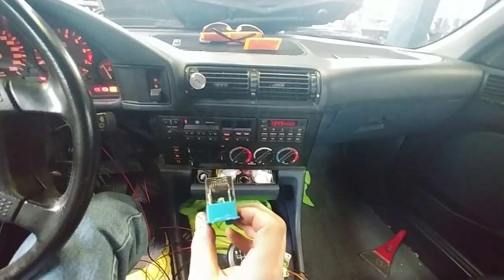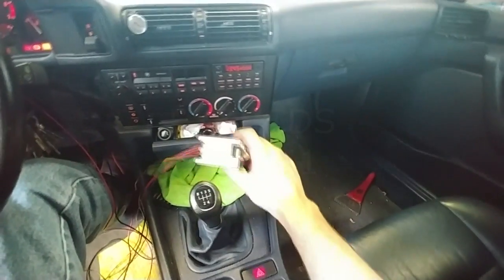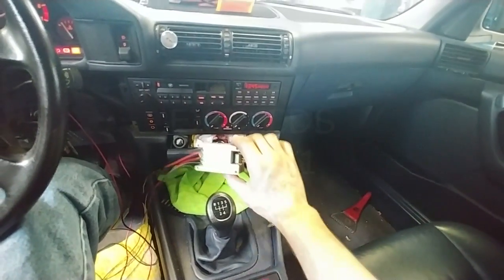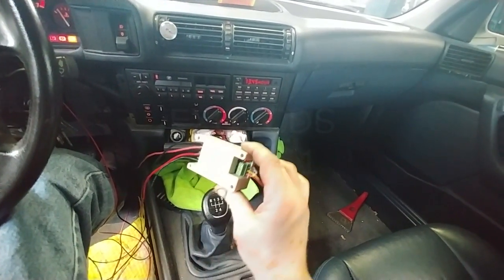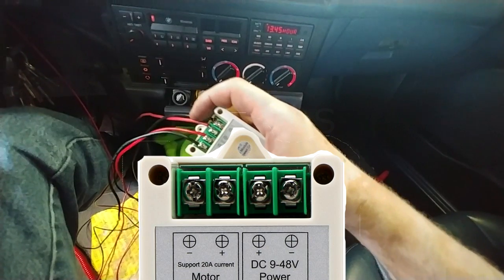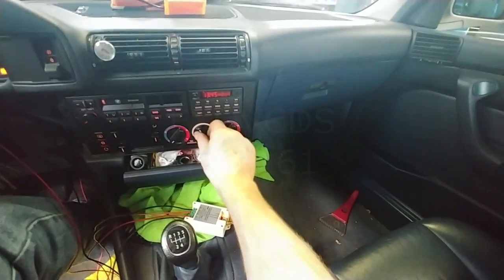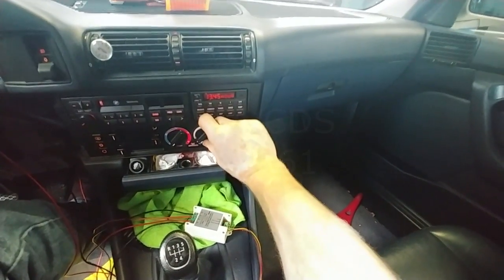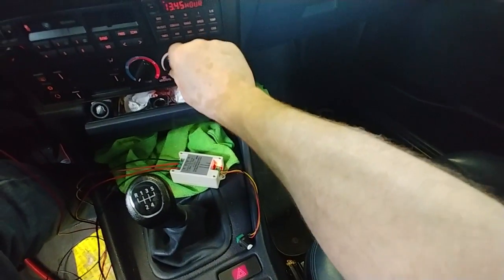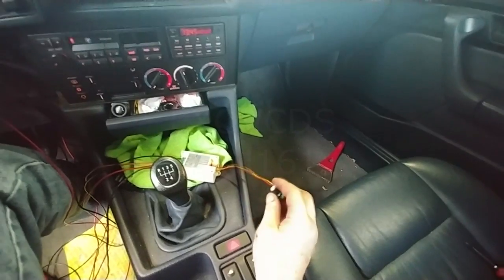Since this is a fire hazard and I don't want to keep it that way, plus I don't like the fact that there's only four speeds, what I ended up doing was similar to what guys have been doing on the Vanagons and T3s — they install a pulse width modulated controller. You've got your ground and power in, and then power and ground going to the motor. When I turn this off of off, you can see there's a little LED light that comes on, and now I can infinitely adjust the speed.